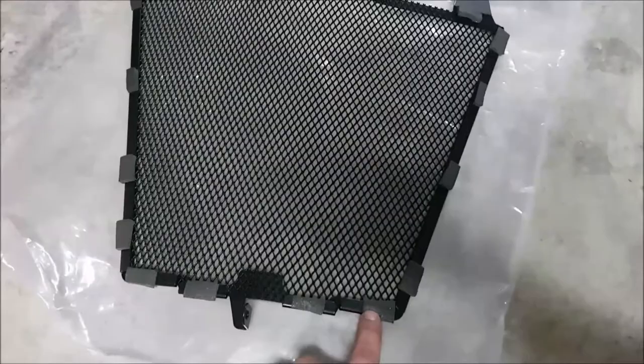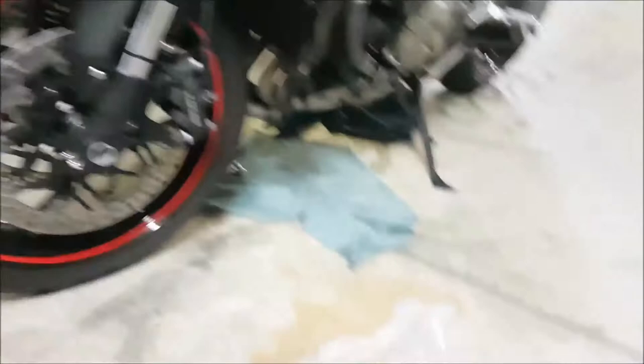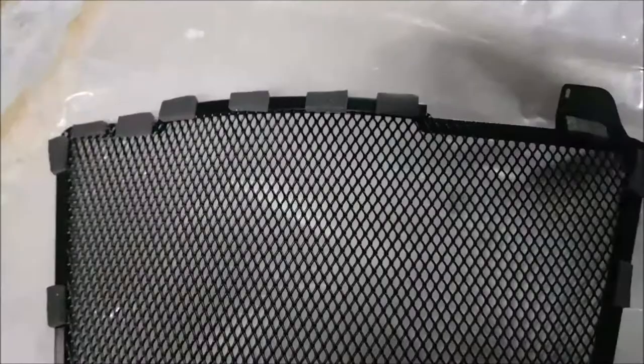I've applied sticky foam around the radiator guard — that's to stop vibration. Now I'm going to offer it up to the bike, bolt it in, and then zip-tie the top. This is the one they say to zip-tie; there's another hole but they say don't zip-tie that unless it's a race bike with the ABS cables cut. So the only mounting points are the bottom bolt and the zip tie at the top.